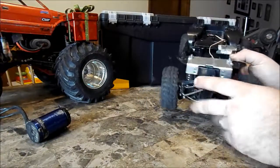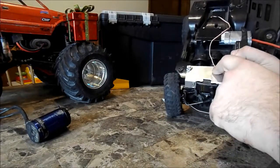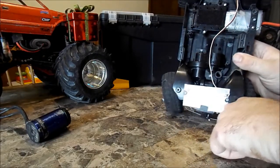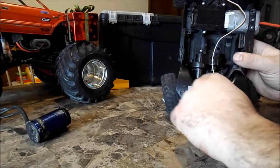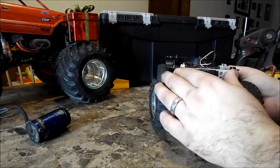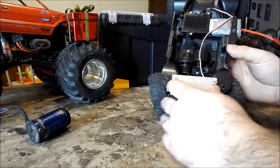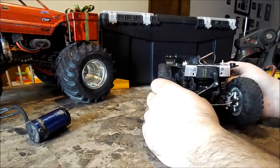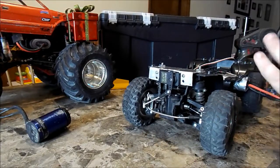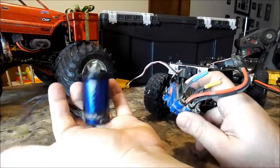One thing I did as well, I rebuilt the bracket here for the servo setup. This was C-channel aluminum. I cut off the edge, cut it really crooked as you can probably see. I cut off the leg here, I guess you'd call it, and custom fit it to hold a servo. Made notches to clear these screws that hold the front shocks on. This actually works. I tested this. For the most part, it's a roller. I have an ESC motor setup in mind already. It's going to be pretty fun.